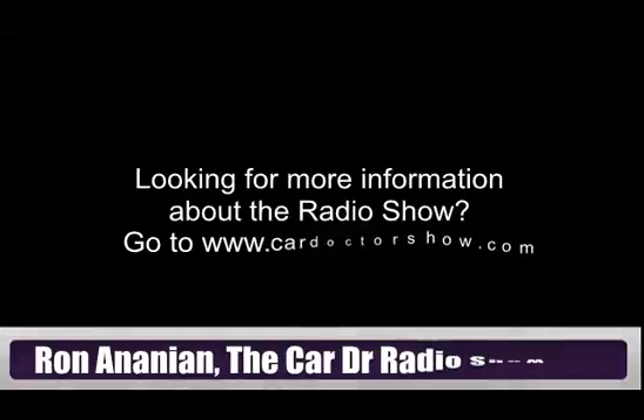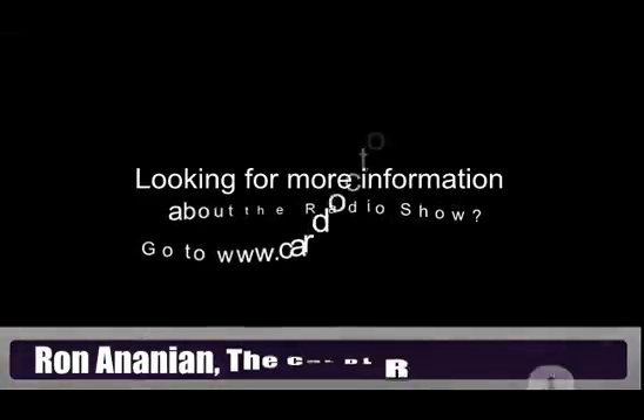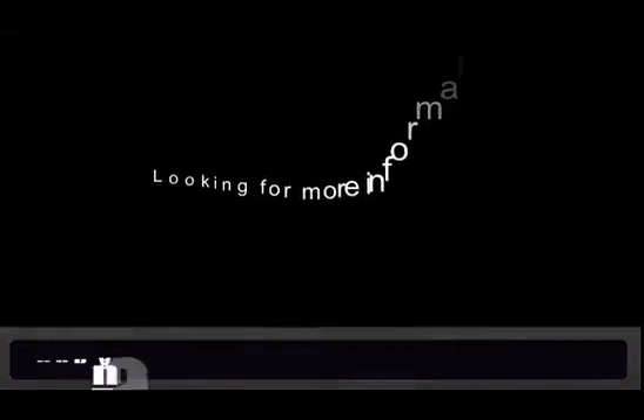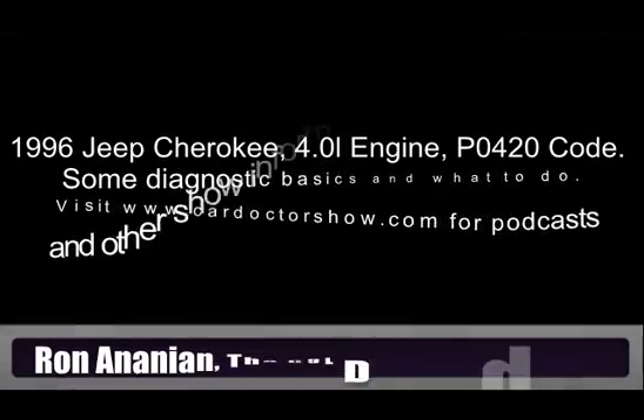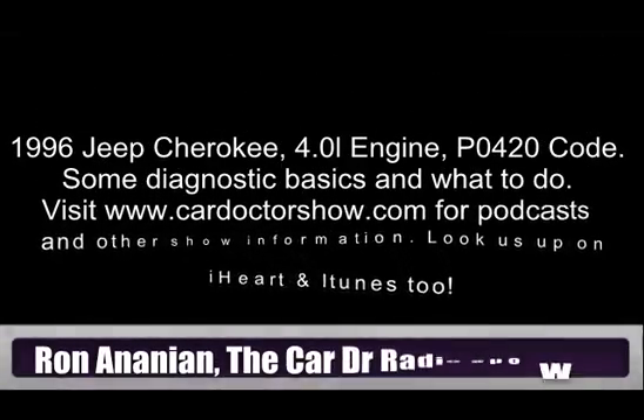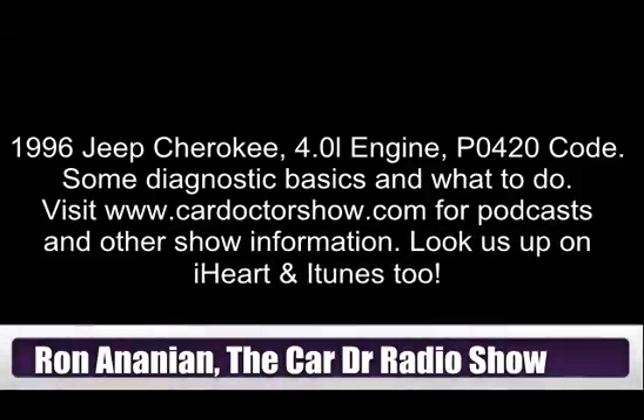You'll see that rear O2 at a fixed high rate, and that way you know the cat is working. This has to be observed under certain conditions. If you want to Google it, look up the oxygen storage capacity test for a catalytic converter — that's one thing we look at. The other is an oxygen sensor switch rate or ratio test of a catalytic converter. All of this requires a good scan tool or the ability to look at both sensors on two separate multimeters.